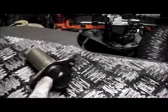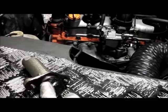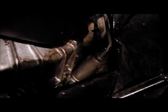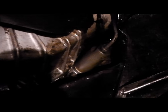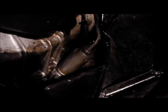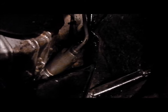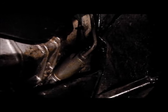What you've got inside: the piston just has a concave shape, so the push rod centralises on that - quite simple. The new slave cylinder is now fitted. I didn't film fitting it because it's a bit of a fiddle, but it's pretty simple. The push rod just has to be located in the little gaiter rubber cover on the end of it. Getting the bolts in isn't too bad - a bit of fiddling about - but the trick is to leave them loose. Just put them in a few turns and then connect the hydraulic line. If you bolt the cylinder up first you'll never get the hydraulic line on because they have to be absolutely straight - don't cross-thread it. Just tighten it up enough; it doesn't need to be too tight and you don't want to twist the pipe. Once you've done it, dry it all up and get rid of any oil so you'll be able to see if there are any leaks later on.